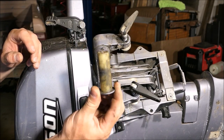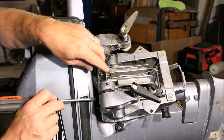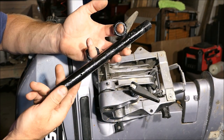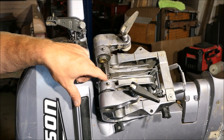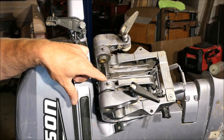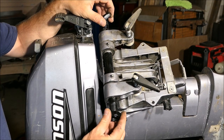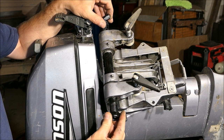That's what they look like right there. There's a washer that fits right here — we're going to reuse that. This is called a tilt tube and it has two nuts. I spray-painted it because it was a little rusty. With your washer in place and a little plastic bushing left in there, we'll just shove the tube up through there. I'm going to temporarily put these nuts on so I can get this engine on the boat, because I'd rather work on it there.